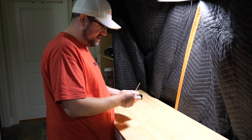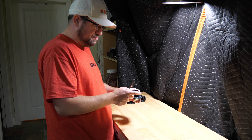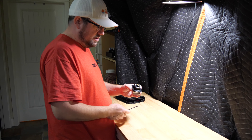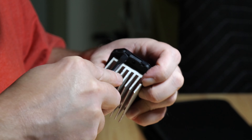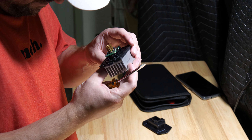This is the part in the car that basically controls the cabin fan. If this is burnt out, it doesn't matter how high you put the fan — it's not gonna run. The internet tells me that if I pry this off there are two terminals in there that are shorted, and I can just fix it with a jumper wire and then put it back in the car.